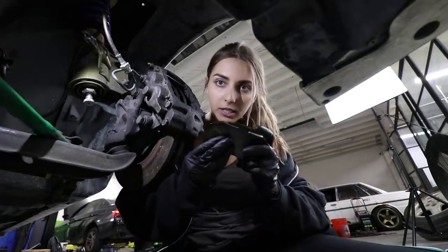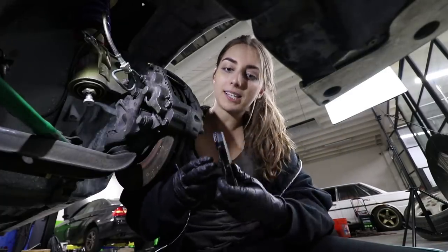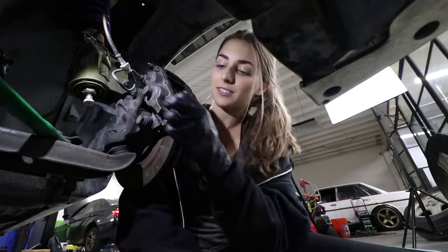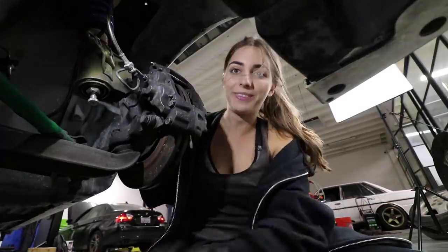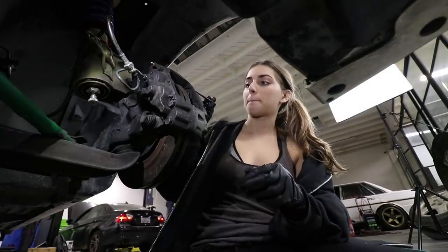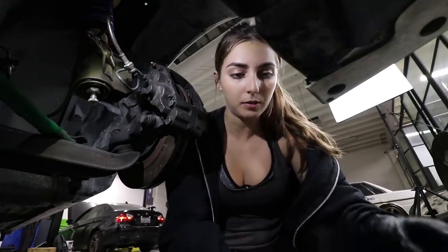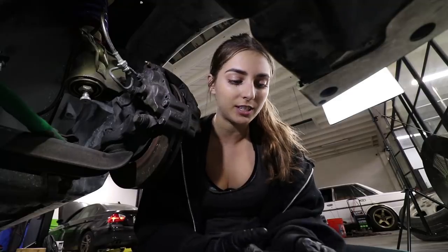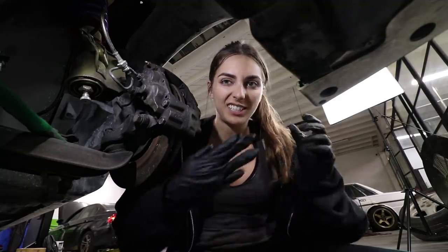I'm gonna put the rabbit ear, the little squealer when you get too low, on the backside though. And I'm gonna lube up the backside, and I'm also gonna lube up these little pins. I'm gonna put this on a clean surface, and I'm also gonna take my glove off for this because it's not as messy if I can contain it inside.